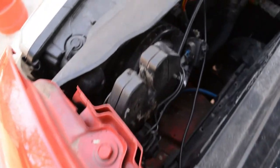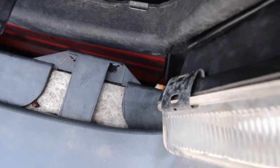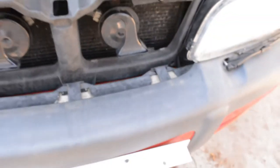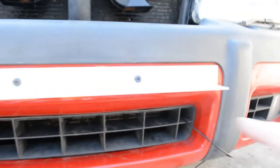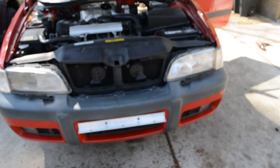With the relay roughly in place, I ran the black power wire behind the headlamp, in front of the radiator support, down behind the front bumper, and then through the lower grill. Obviously with the wire running through the lower grill like this you can't remove the grill without removing the wiring. I personally don't have an issue with that — if I need to remove the grill I can just unplug the relay and fish the wiring out that way.